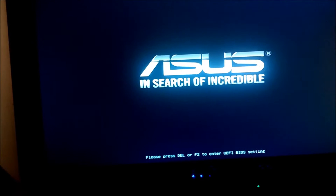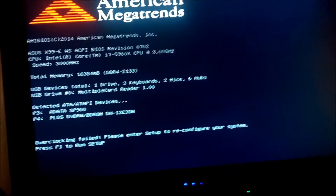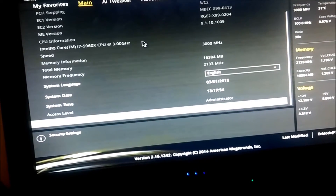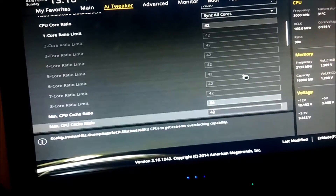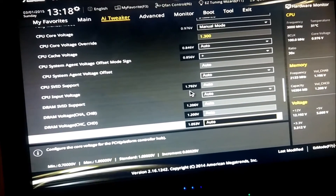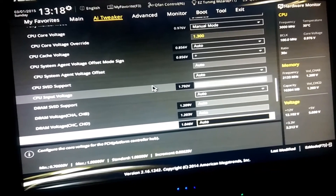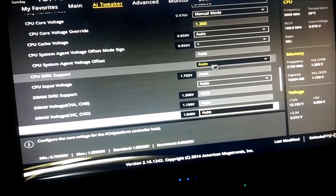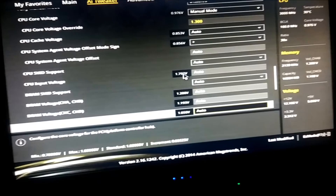Now it's rebooting indefinitely. So — 1.792 or 1.8 volts now. Before it was at 1.92 volts. I still don't like it. Why is it so high? It just seems too high to me. That seems like the voltage I'd want for a Core 2 Duo overclock.